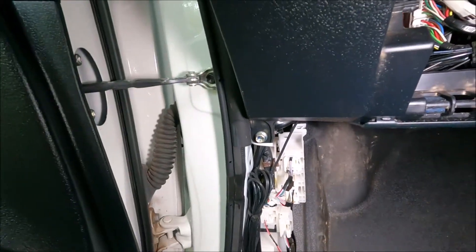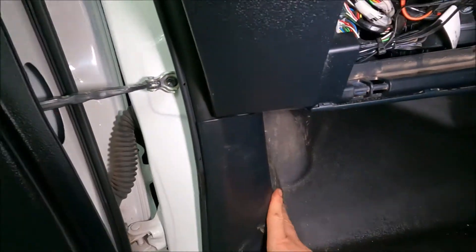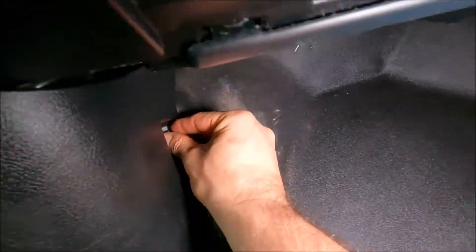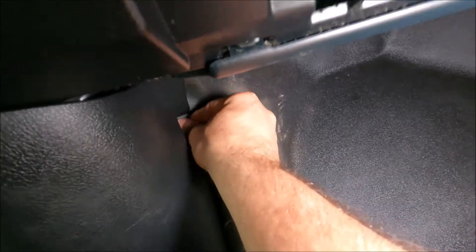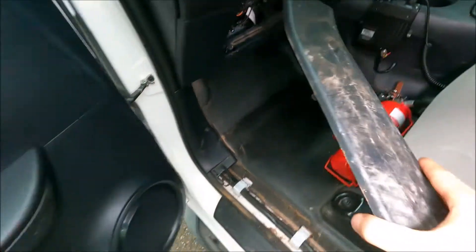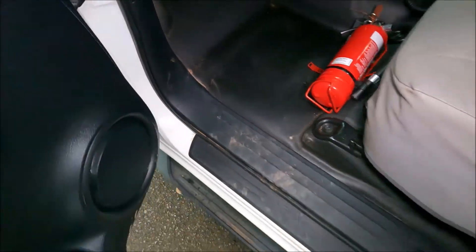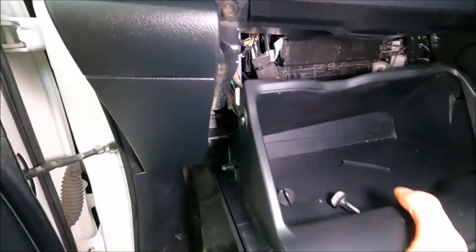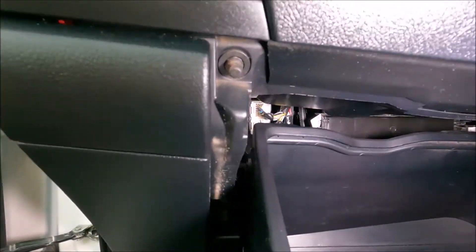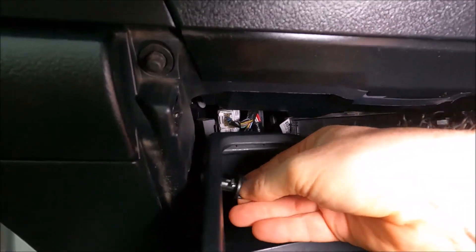To put the plastics back on it's relatively easy — just line up the bolt at the back first and click the plastic into position, then do that plastic nut back up. As I say, you can do it with your fingers, it's not too hard. Once you're happy with that, get your plastic trim, line it up, and pop it back down. Then get your glove box, line up the two hinges, push it in once lined up, and put the two stoppers back in. The stoppers only go on in one direction.